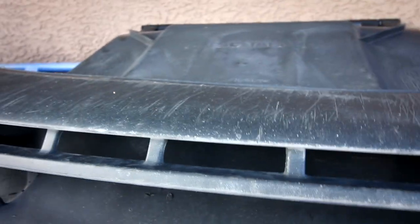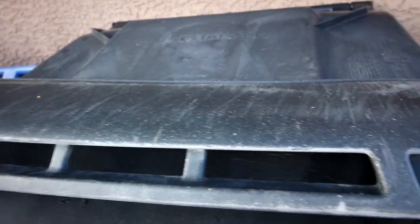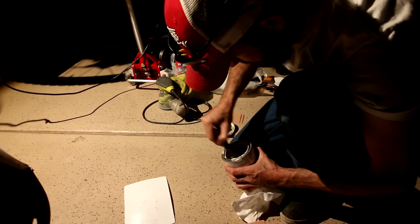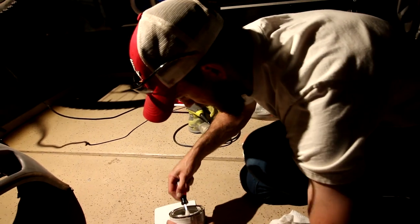This entire trim piece has been cleaned with Nanolex X, which is basically like an alcohol substance. This thing is in horrible condition — it's actually faded, whereas the black is just bleached white. Charlie just got here and I was showing him the progress I made on the bumper, and he suggested that I do a skim coat of Bondo now over the entire area where I did all the repairs. That stuff smells absolutely horrible. So basically what I'm gonna want to do is just put like a 32nd of an inch — a really thin coat — over the whole thing.